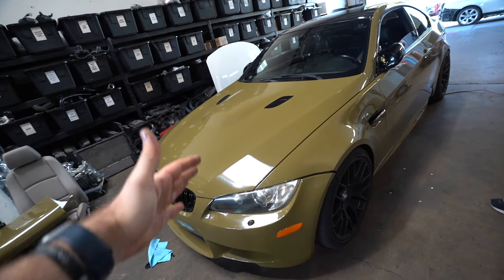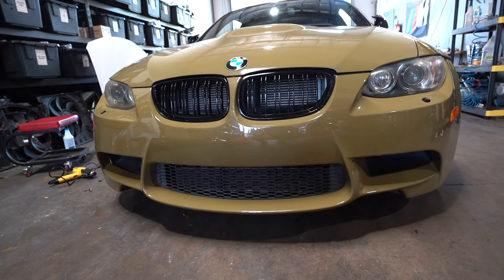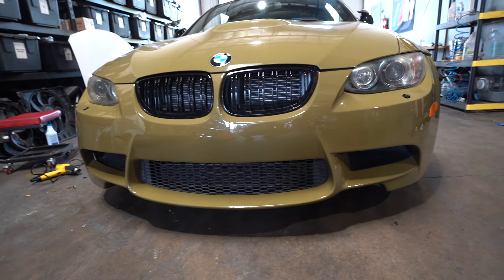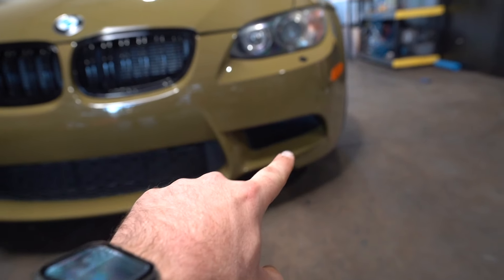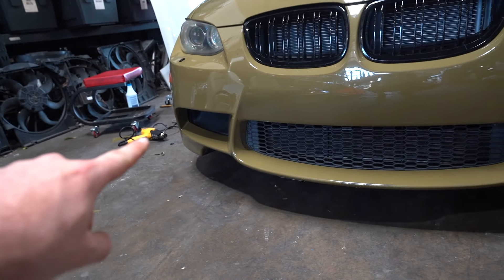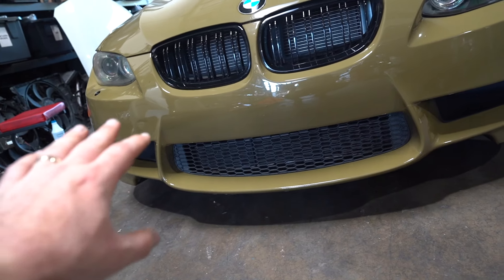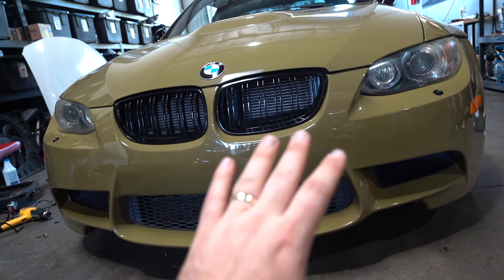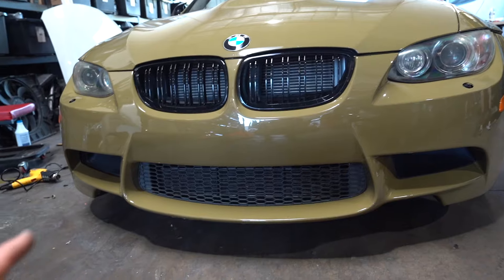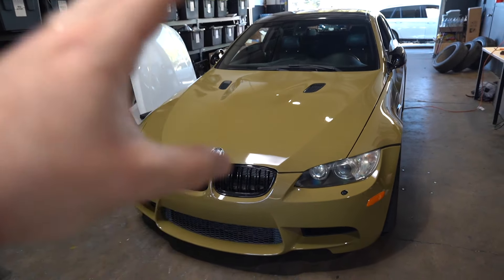For the front and rear bumpers, those are typically the most difficult part of the vehicle. You'll have to use a lot of overlays on the bumper — small pieces cut out and placed on top of each other — because it's really hard to get one big roll across the whole bumper and mold it into position. Use overlays on the bumpers if you have to, but try to avoid them on every other panel. The only acceptable area for overlays is the bumpers — not the quarter panel, hood, or anywhere else.